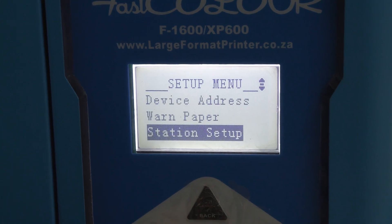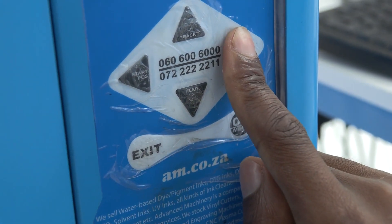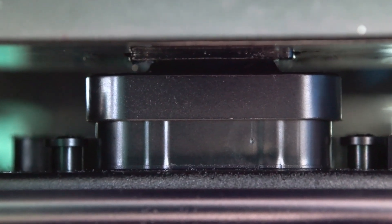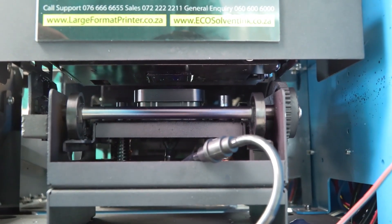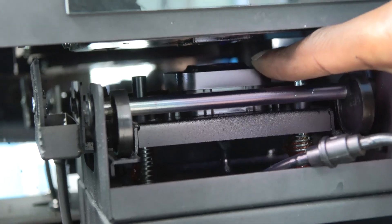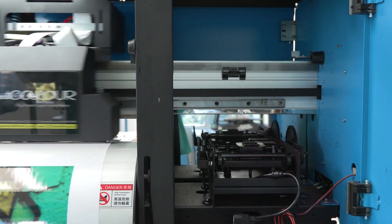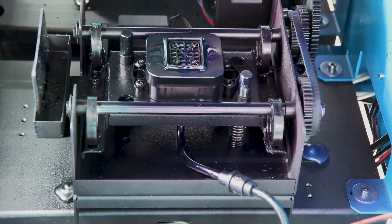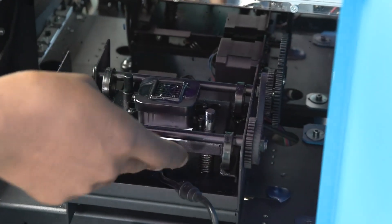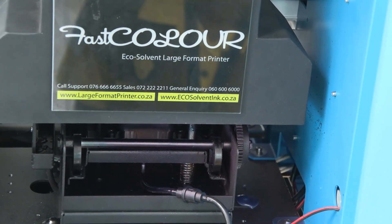For the A-Tool system, go to Station Position, click Adjust, and use the arrows to move the station position left and right. When happy, press OK. However, if the ink cap cannot touch the print head even at its highest point and cannot create a perfect seal, note that the ink cap must squeeze into the head by about two millimeters — the rubber edge deforms and the spring underneath activates. If you previously raised the whole carriage, lower it back, or raise the cap by placing spacers underneath it. Always manually move the carriage around to check it doesn't jam before switching power back on.